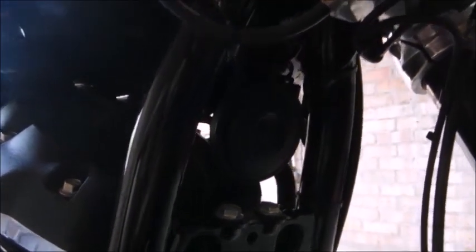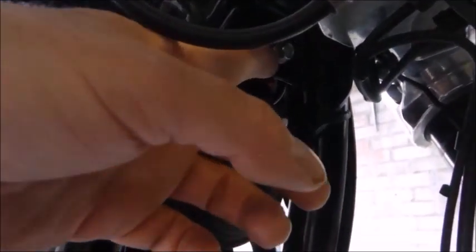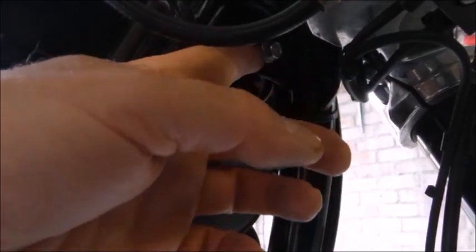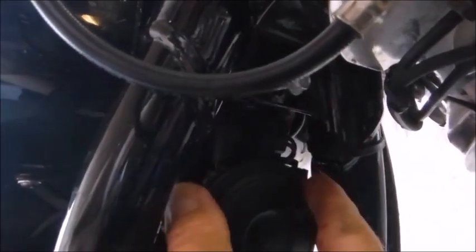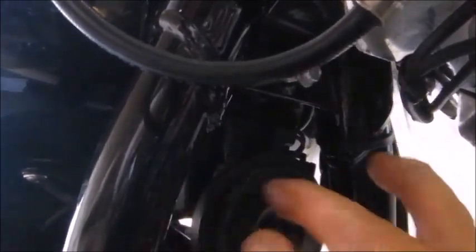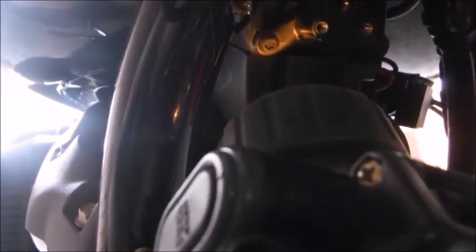So a little bit of faffing about, but at the top straight above the horn there is a 3/8 inch bolt. Undo that bolt and the whole bracket that's supporting it drops down, and then there's two further screws to undo. So let's undo that bolt first. Once you've undone the big bolt the whole bracket assembly drops down, and then you've got two Torx head screws to undo, one on either side of that bracket. Then the whole horn assembly will come out.